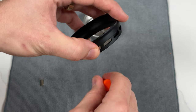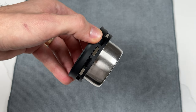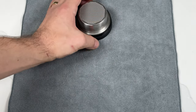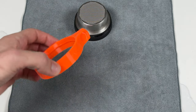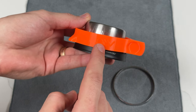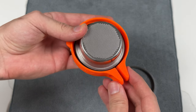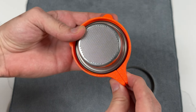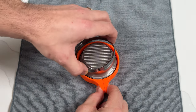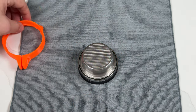If you plan to configure the funnel at half strength, be sure to attach it to a basket to help retain the magnets and prevent them from falling out. Once you're happy with the number of magnets, it's time to reassemble. Flip the portafunnel upside down so the bottom is facing you and grab the sleeve removal tool and the sleeve. Making sure that the orientation is correct, place the sleeve removal tool over the funnel and align it so that you can squeeze the tabs completely closed. While holding the tabs closed with one hand, use the other to place the sleeve back onto the funnel. Once you have the sleeve reinstalled, simply remove the orange ring and you're done.